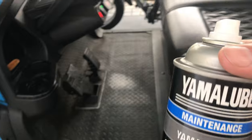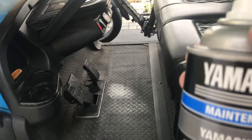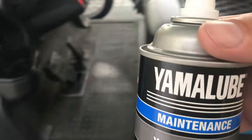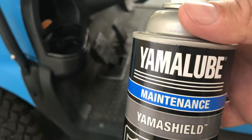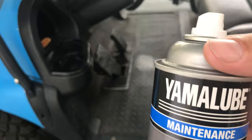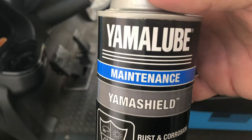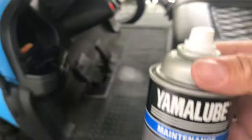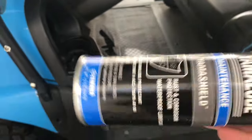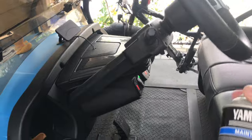Other things: keeping the right tire inflation is not hard. Go buy yourself a little 30-dollar Ryobi compressor with the tire pressure readout built in — easy button. Check your tires once a month. If your climate changes from cold to hot seasonally, check them because the air pressure will change. Little things like that keep your vehicles going. The lube goes a long way too — it takes away squeaks and makes handling, especially on the cart, a lot easier for turning and steering.